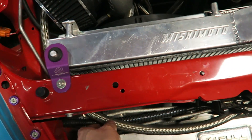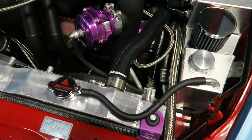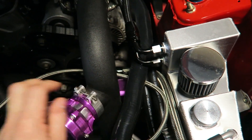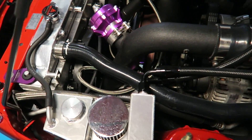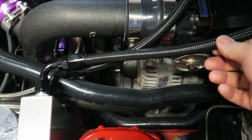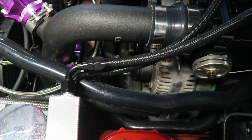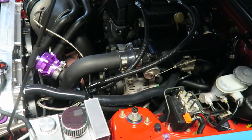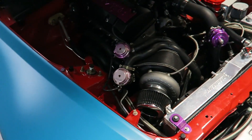See all this stainless hose just wrapped all the way around everything — see how tight it is through there? The turbo line is way long, there's nothing supporting it. The catch can right here looks nice, except this hose is laying right on the throttle. This is not good, this will cause a problem. So this has to be shortened to get it away from that. We're going to make everything black so everything matches and looks better.